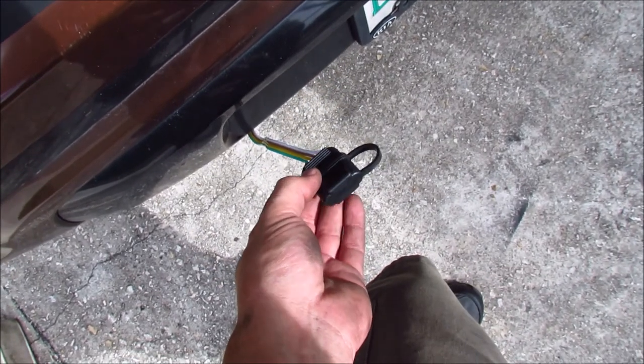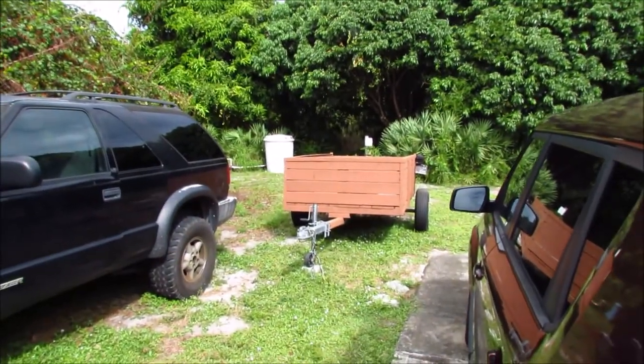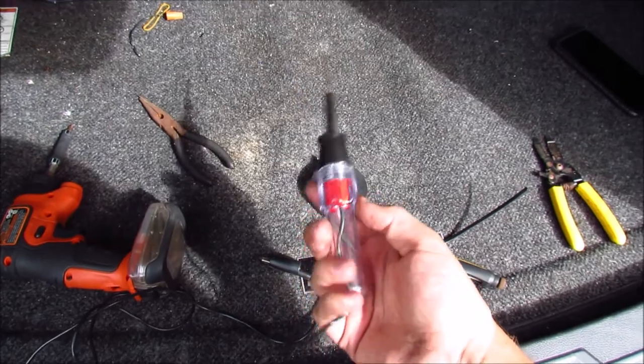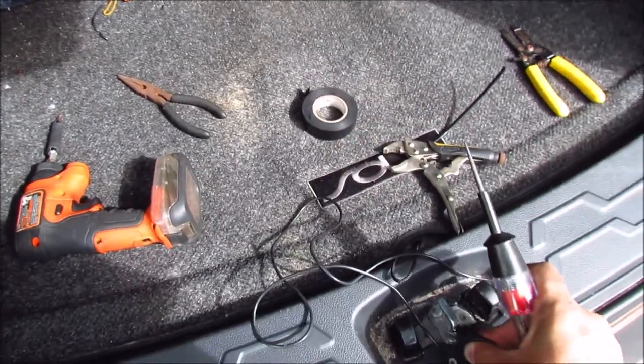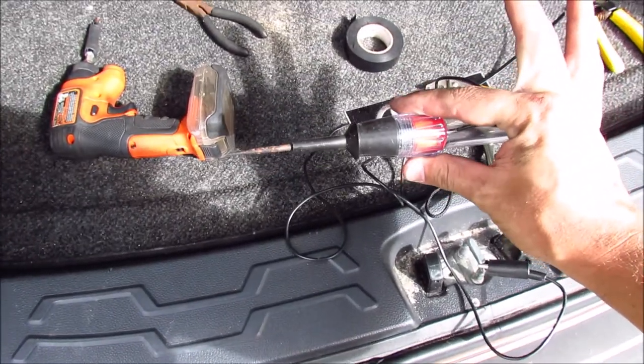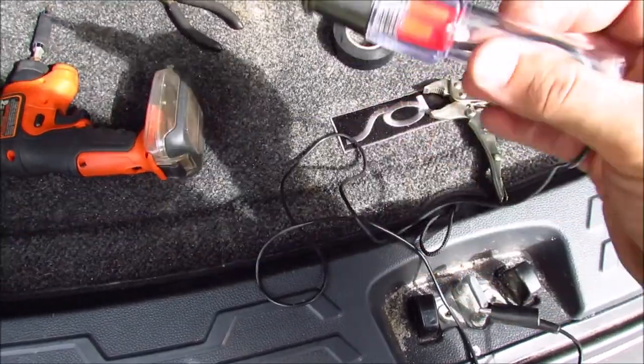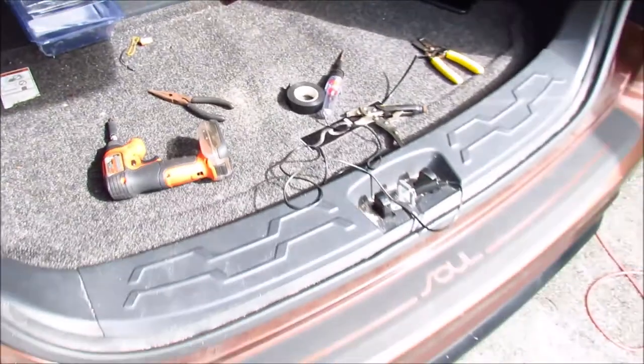Now there are two ways to check everything. One: plug it back into your trailer and see if you have lights. Two: get yourself a test light — I got mine at Harbor Freight for five or six bucks. You basically tie the ground end off somewhere and plug the other end into the circuit that should have power, and the little LED bulb inside will light up. Go ahead, check everything, make sure it all works. Thank you for watching this episode of $1,000 Car Guy — I hope it was a thorough enough install. If you got some good information out of this, please click the like button. I'll leave the link to the kit in the description below. Happy trailering.